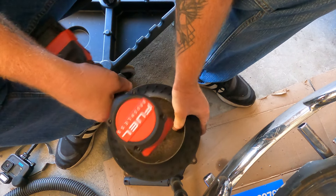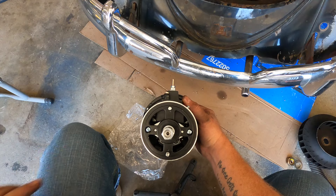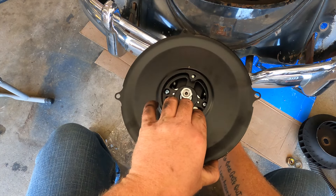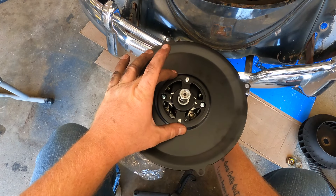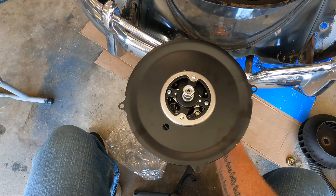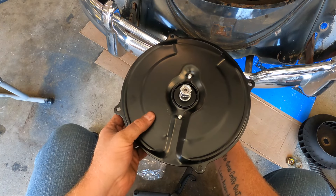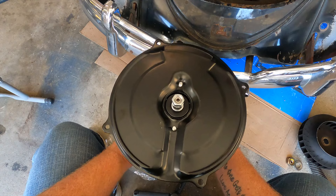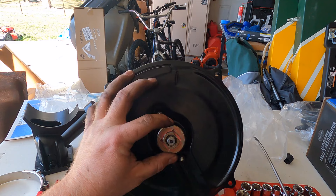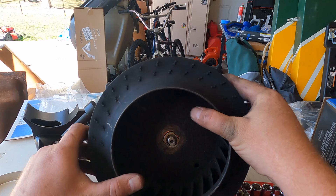Before we assemble the alternator and stuff, we need to take off this fan. 36 millimeter nut — you want the post on top, you want the breather hole on the bottom with the bevel going downwards. Put the spacer on it, and then you want this groove facing down again. I'm going to take the hardware from the other one to secure this once you get it pressed on.